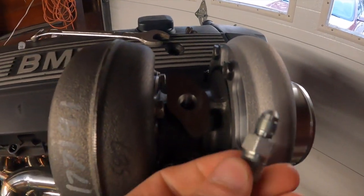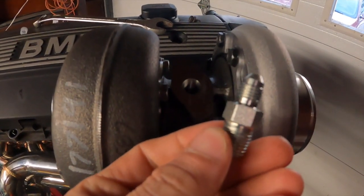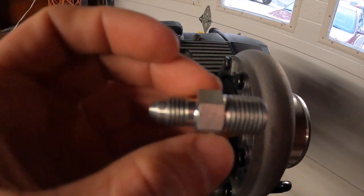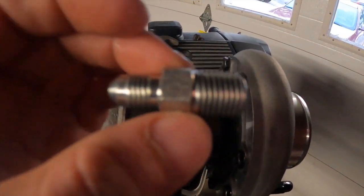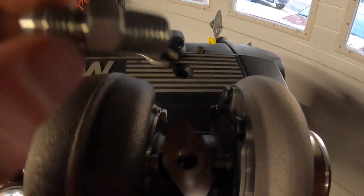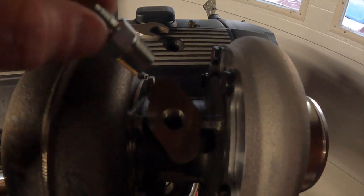Next is the turbo side fitting. This is what's going to give you oil to your turbo. I have a Borg Warner, so yours might be different, but I'm pretty sure all the Borg ones are exactly the same thread — I'll link it below. The cool thing about Borg Warner, and I think Holsets too, is they have a restrictor built in, so you don't need an external oil restrictor when you plumb it. There's a tiny little hole in there and that's your restrictor. Garretts usually do need one, but just a fun fact — it'll be linked in the description.